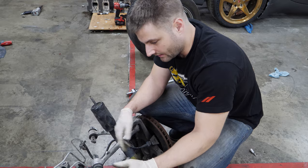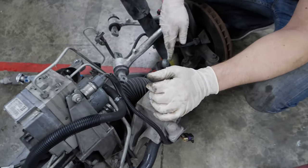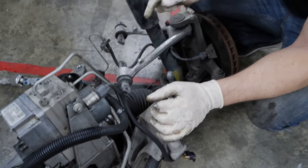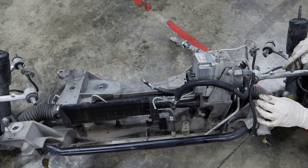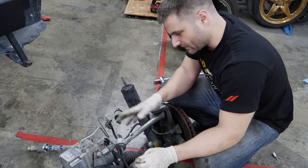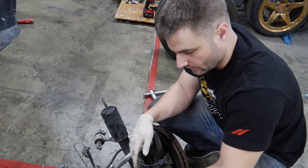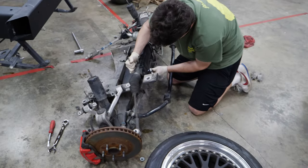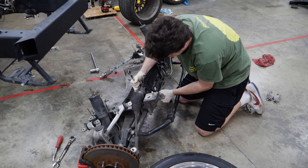After a little off-camera discussion, we are actually going to take the sway bar, anti-sway bar, lower control arms, and steering rack — we have to take it all off. The reason is we're going to be test fitting this so many times. We could cut it and have scrap metal flying, but when we go to build the actual engine subframe we're just going to be refitting it so many times and it is heavier, which slows things down. So we're going to super speed through that and get right through it.